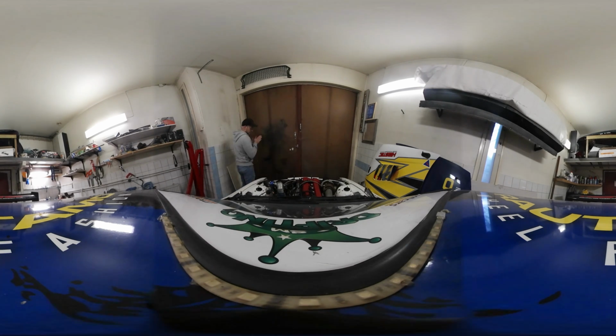What else is there to mention? About the engine management, in the front over here I have made this wheel that connects the fan belt. It's bolted with 6 bolts, and I have made a part that goes between those. I put in longer bolts and the part between, and then I have a trigger wheel on the end of the crank, and a trigger sensor from a Volkswagen Golf, I think it was.